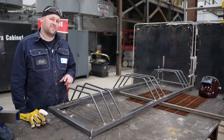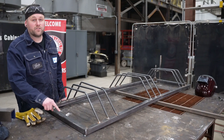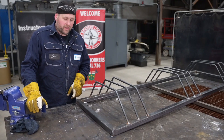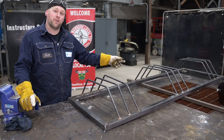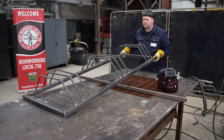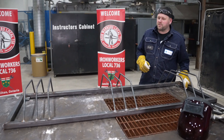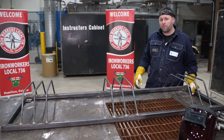Pre-stressing something like this can be dangerous. When removing it, you would want to come in here and cut these tacks first. We're going to start on the clamp side and let them out slow. We can also lift up that far side of the frame and let these tacks break. Checking out the frame — it is up a little bit, so we may have pre-stressed it about a quarter inch too much. Considering the amount of back-bow that we had, I'm happy with this result.